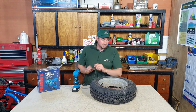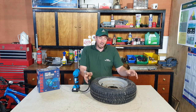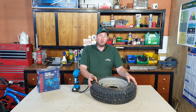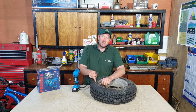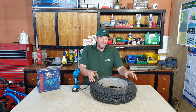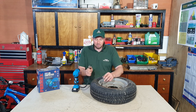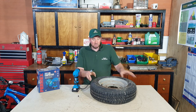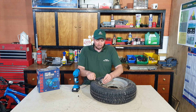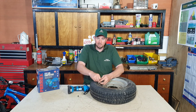I just want to make sure - this is a brand new tyre fitted to this rim, sitting in the corner of our yard. We're always after new wheels and tyres as they get scraped and worn out with a big trailer. But the real test will be pumping these up. Most car tyres are anywhere between about 25 to 35 or 40 PSI max, and these go up to 90 PSI - I run them at about 60 to 65. So if it can handle that, I'm happy it can handle anything. Let's give it a quick blast - since we've had this one fitted, it'll have gone down a bit because it's been there a few months. New tyre on an old rim - they're always a bit leaky.